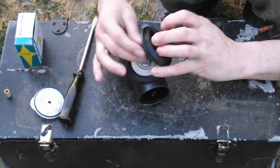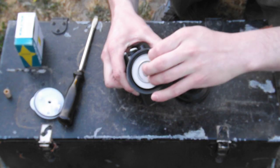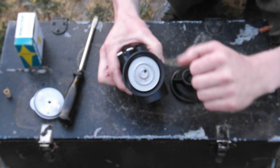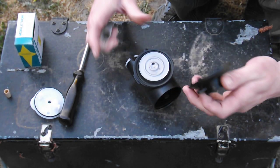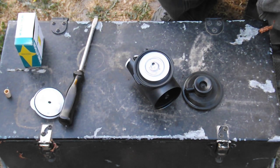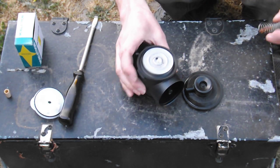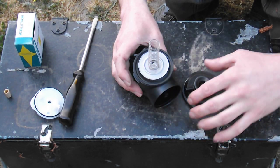Make sure your diaphragm is - make sure when you put this cap on it gets pushed down squarely. And this diaphragm is where it should be, because if the diaphragm is pushed in, it's just going to rev its nuts off - it's not going to be governed. This diaphragm system has a little what they call a vacuum button in the bottom of the crankcase, and the flywheel fins - cooling fins or fan - whizzing past that button creates low pressure. That's proportional to the engine speed, and that's what actually dictates how fast or slow the engine goes on full throttle.